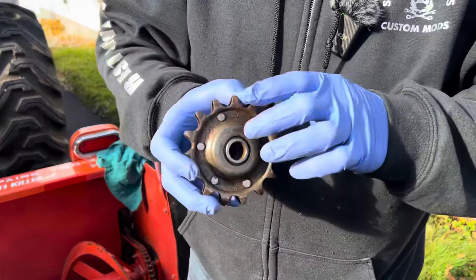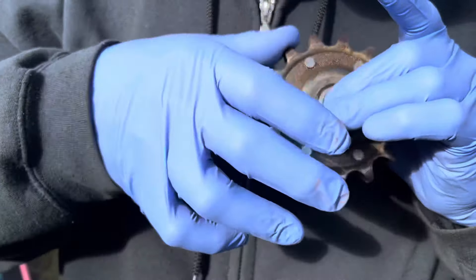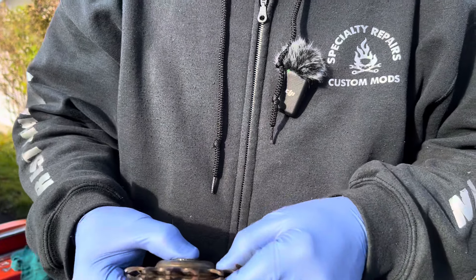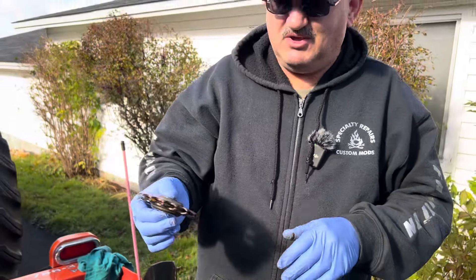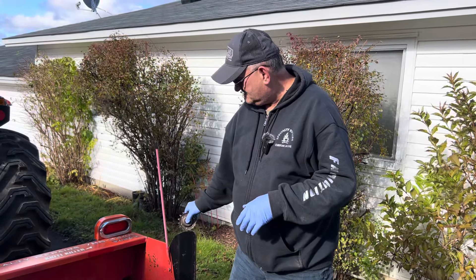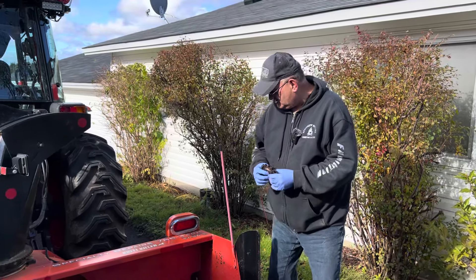I don't know if you can hear this — just listen. It's rough. That's the sign that it's telling you it wants to retire from this job and you need to get a younger one in. So we always put a new one on. Grease down the chain good, re-adjust it. The adjustment is here — there's a bolt here and the nut is on the other side, and you just adjust it by sliding it up or down, whatever you need.